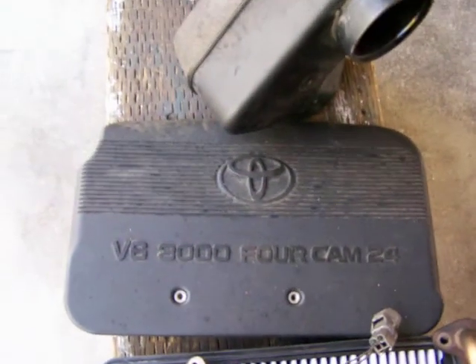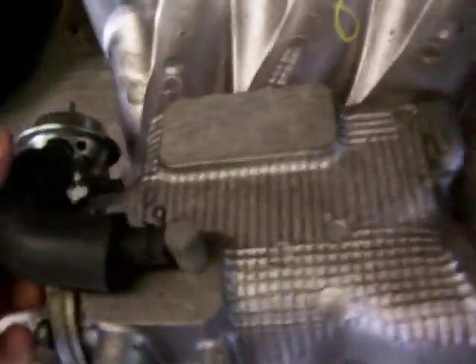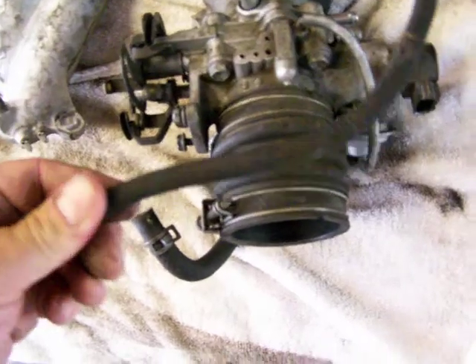This cover comes off with two bolts — no brainer. Remove it and take the air filter out so you don't damage it, then you'll remove the intake. Remember those two bolted hoses — these are the coolant ones that cool the throttle body. You're going to unplug your TPS, your throttle position sensor. This is your PCV — I forgot to disconnect it and broke it in half, but it's no brainer, just replace it. Most of the hoses were dry and hard as a rock, so be very careful not to break any plastic fittings — being a Japanese car, they probably cost a million dollars.